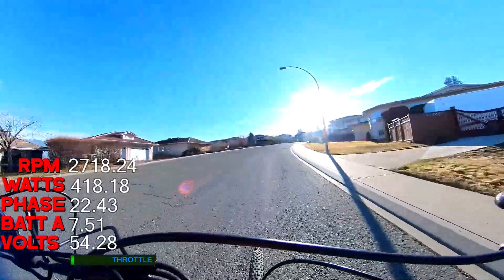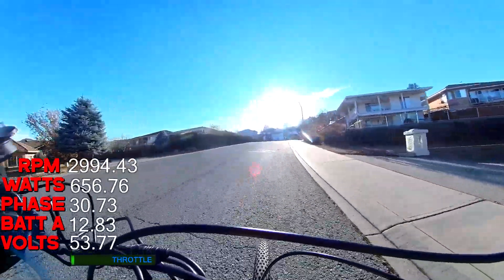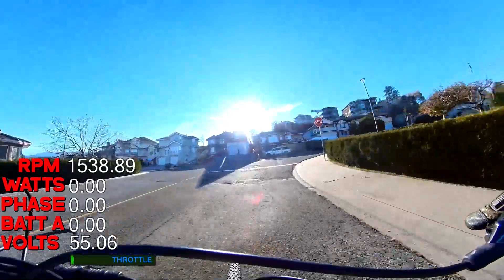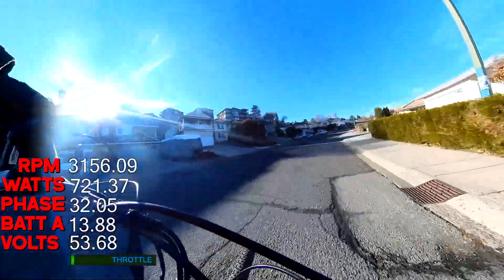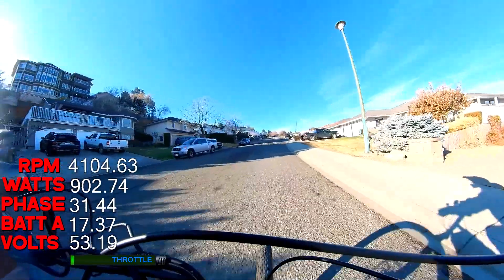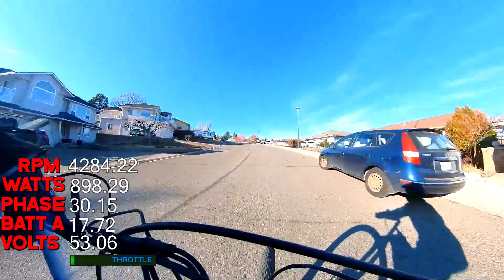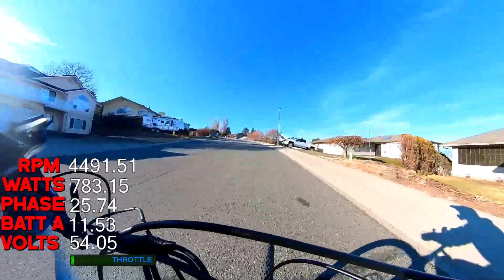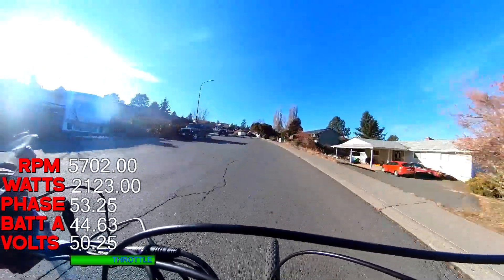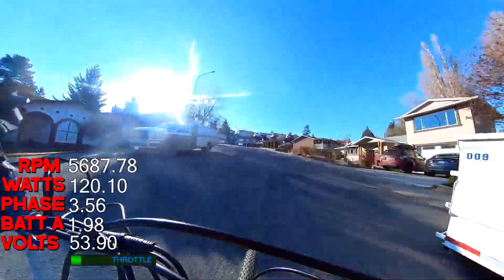It's kind of difficult with the higher power stuff with the BBSHD to get it to feel good, but I've bumped it up now to level eight and it's good feeling. The chainring is a little bit big at the moment — it's like a 46 tooth — and my cassette's biggest is a 32 tooth, so finding the right balance between front and rear is tricky. I'm going to talk to 27 and see if it's possible to get maybe a 42 tooth or something a bit smaller, because I think that'll provide a better balance.